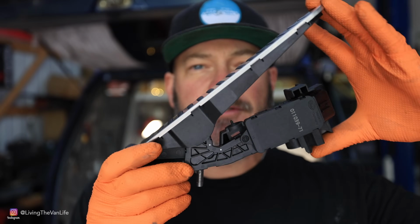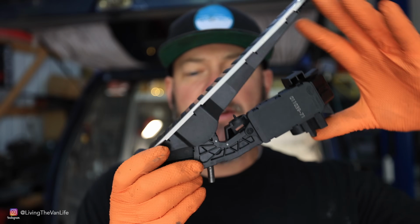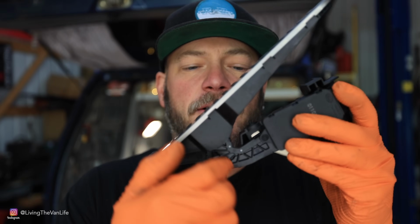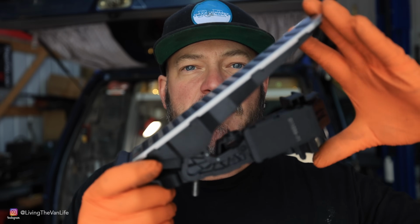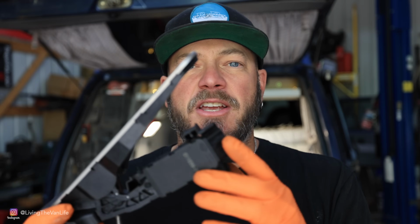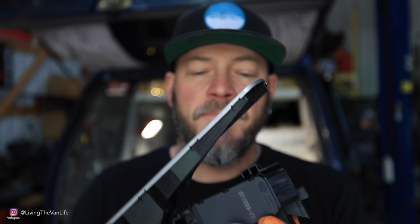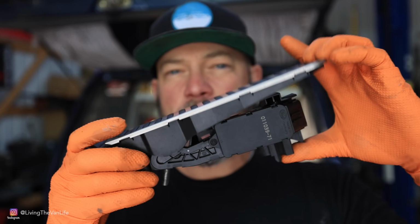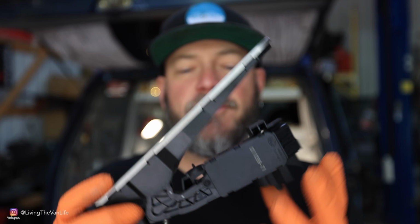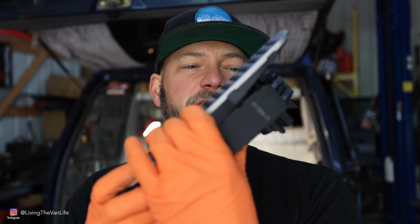It operates and functions just like a regular gas pedal at your foot from the driver's position. However, inside this pedal is a potentiometer that is built in, and that is measuring the position of the foot pedal and sends a signal to the engine, and then the throttle is electronically engaged and the engine goes and you're zooming down the road. Now the benefit of fly-by-wire is that you have much more accurate throttle control. There's no physical cable that gets all gummed up and actually needs maintenance. So really, it is nice technology to have in your vehicle, and that is actually how the TDI works. It is a drive-by-wire. So it's a great opportunity to upgrade the technology in the Vanagon.